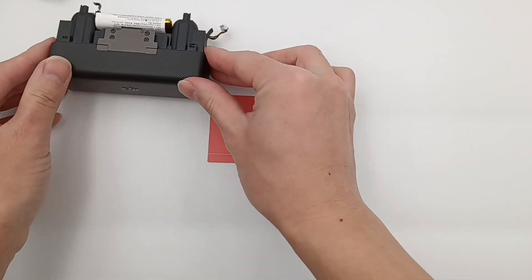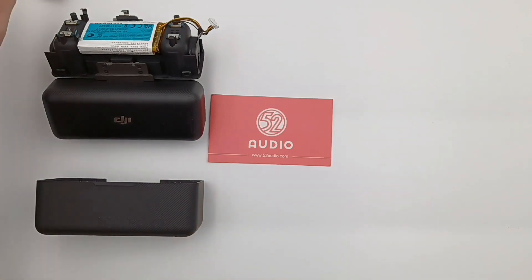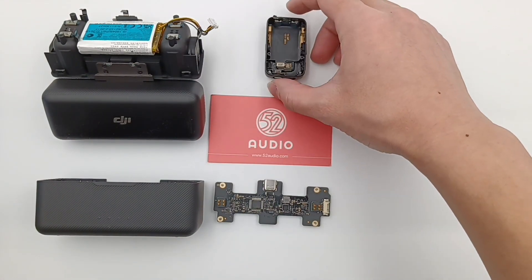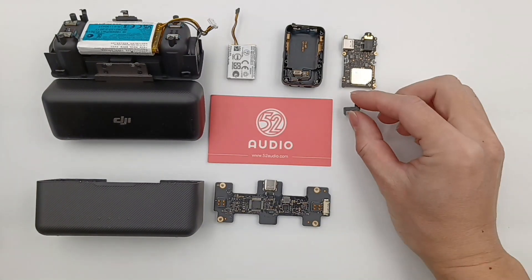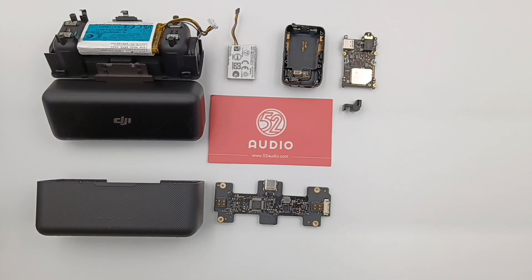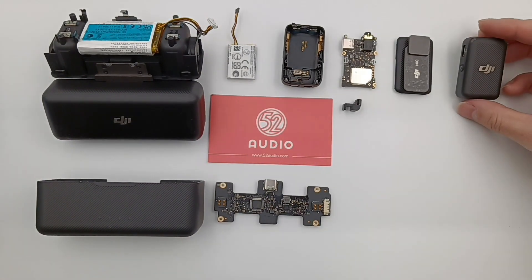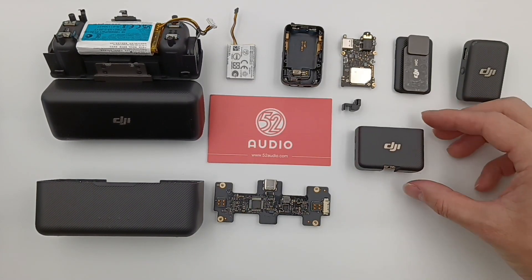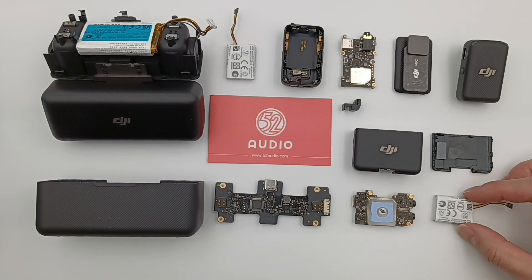That's all the components of the first DJI Professional mic. The charging case integrates a high-capacity battery of 2600mAh that can work for 15 hours. The transmitter is equipped with magnets so you can fix it on any metal surface. The receiver is equipped with a display to show device information, and you can also use the expansion slot to connect it to your Android phone or iPhone, so its compatibility is pretty good. The internal structure of the receiver and transmitter is almost the same — many components are shared, such as the Bluetooth 5 SoC, RF front end, MCU, MOSFETs, analog switch, and charging IC. That's all for today's video. If you like this video, don't forget to subscribe to our YouTube channel and leave your comments about this product. Your support is always our motivation. See you in the next video. Bye.